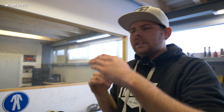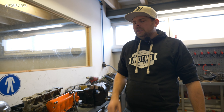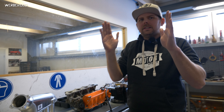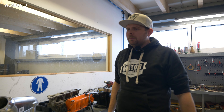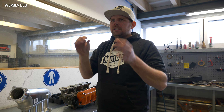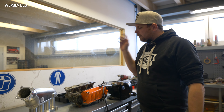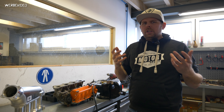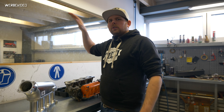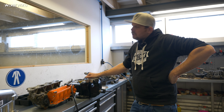When we have Daniela's car on the dyno I'll show you the difference between a standard manifold and this manifold. What I can tell you right now — when you're using a standard intake manifold on an MX-5 NC or MX-5 NA and NB, the power graph will always go flat somewhere around 6800 to 7600 RPM. You will see it in your VE tables as well, and it just flatlines around 6800 RPM. We thought about changing cams — we did change cams and gained power across the rev range — but it was always torquey and then flat. I talked to Lennart and he said, let's just build the intake manifold.